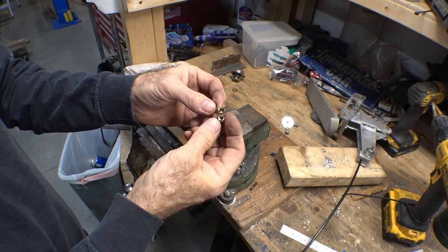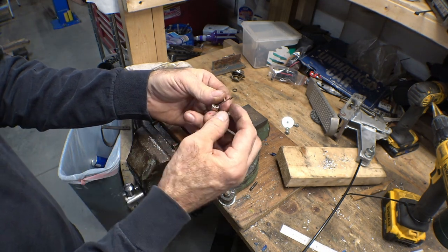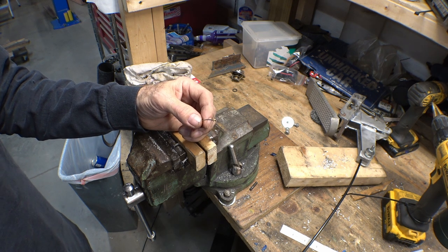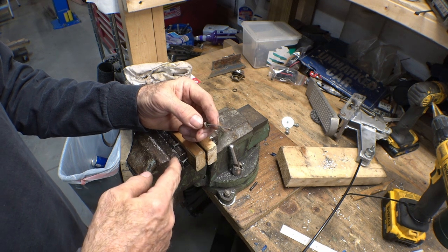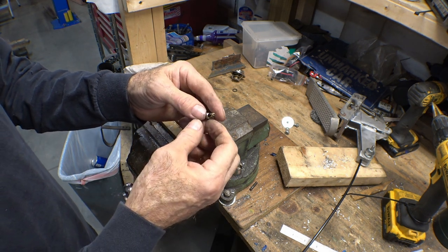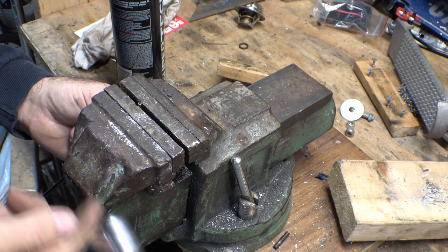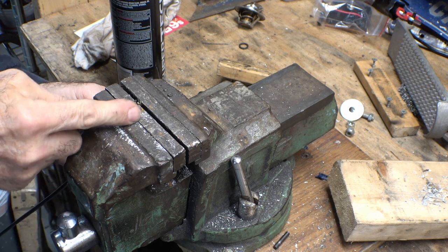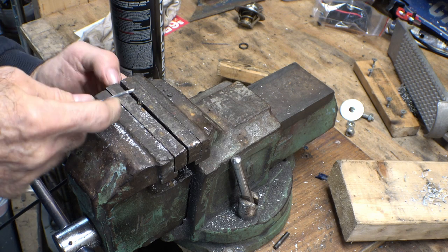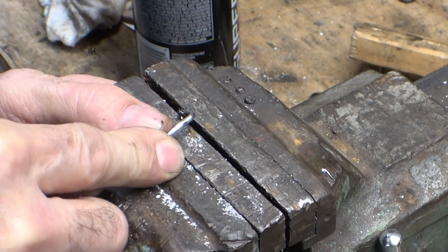I've deburred this before putting it on because they are pretty rough when they come out of the package. I've slid one of these little tiny ferrules over the end of the cable. I'm going to put a ball of solder on the end — I'm just using the solder I have; I'm not even sure what percent tin it is. I did the other end earlier: locked a pair of vice grips onto it, gave it a good foot of slack, yanked on it a couple of times, and it did not even budge — plenty strong for a throttle cable. I've cleaned off the end of the cable with a little parts cleaner, and now I'm going to fray out the end — maybe just a little over an eighth of an inch. That's where it gets all its strength from: the solder holding onto all these little pieces of cable spread out.